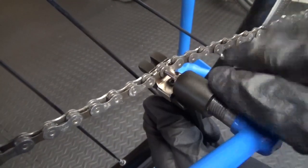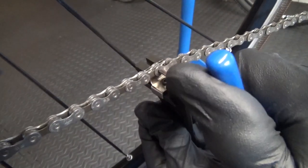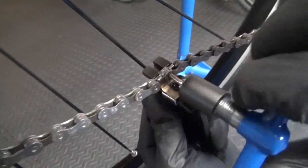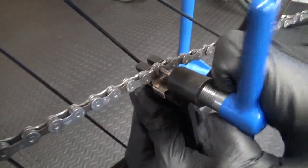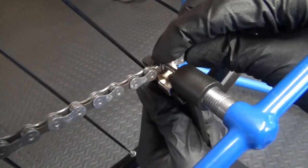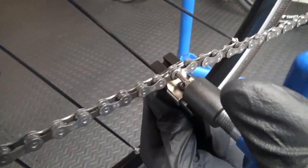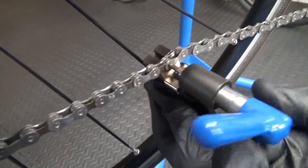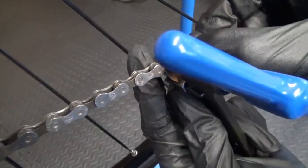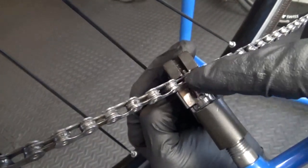It will be tight to start with — you can't just undo it easily — so normally you've got to hold on tight and it'll just pop through as it goes. If it needs readjusting, just take it off, readjust it, make sure it's going through nice and square. So it's initially gone through the outer piece of the chain, it'll go slack, just keep pushing the pin and as you can see it's coming out the back.